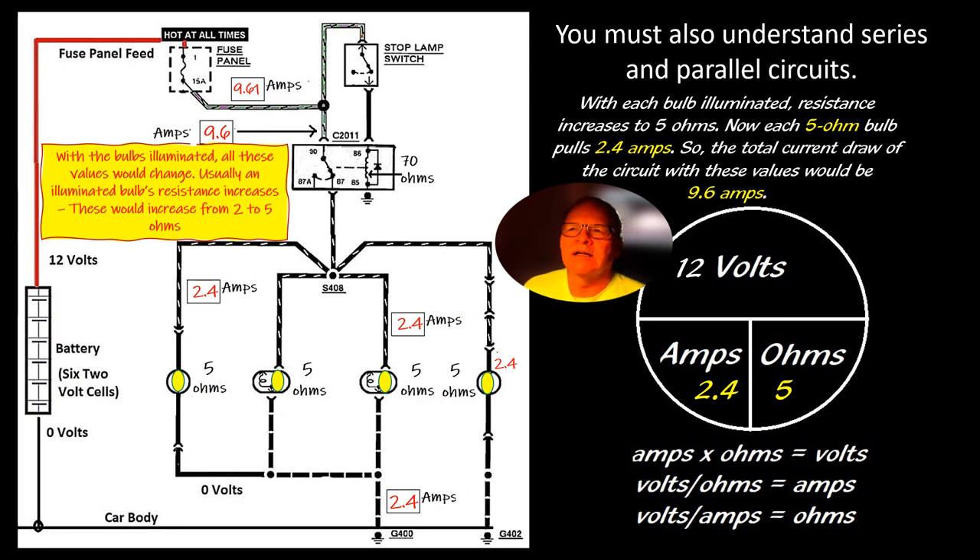Say you're building a circuit — wiring up some buggy — and you need to know how many bulbs you've got and how much each one pulls. This is a bit of a misnomer, because typically the little side marker lamps will have more resistance than these bulbs. The brighter a bulb burns, the less resistance it'll have. A stop lamp filament typically has less resistance than a tail lamp filament because it burns brighter. You've got to be able to factor in that initial surge of current when you turn on the light when choosing your fuse size.